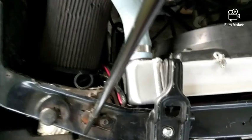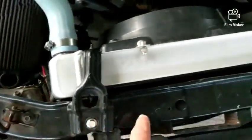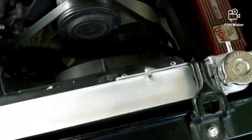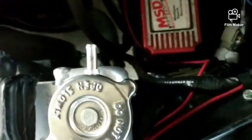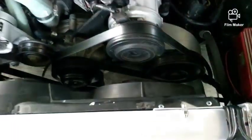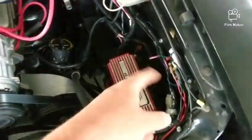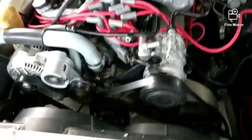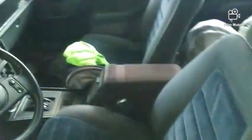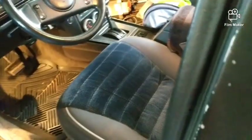Alright guys, you can see it's running finally. Put the radiator in — it is tight, there's not much room down here. I've got an SN air conditioner condenser on here and it's pretty tight over there too, but it fits. The hoses took a little persuading but they went on. I still haven't rigged up the overflow bottle but that's easy. It's been running for about 10 minutes — started at 4:20, it's 4:30 now, and it's sitting at about 185.